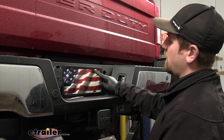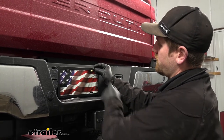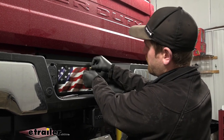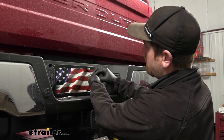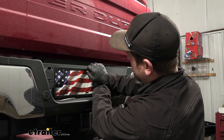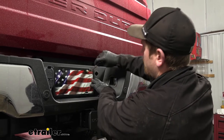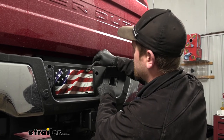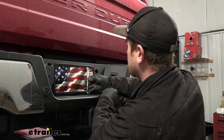Here's where our inflation valve came out through our license plate opening. Take the rubber washer, place that over the end first, then a flat washer, and then a hex nut. Run this down by hand, then grab a half inch wrench and get a few turns on it just to make sure it's snug — we don't want it vibrating loose.